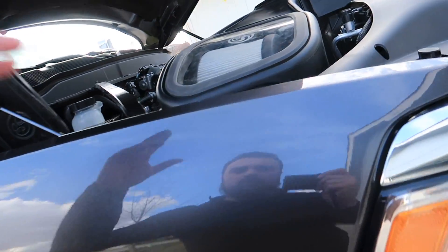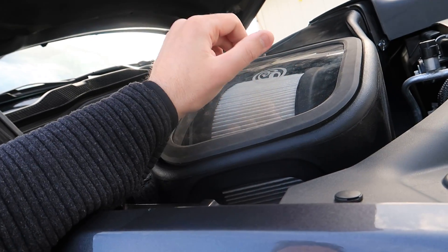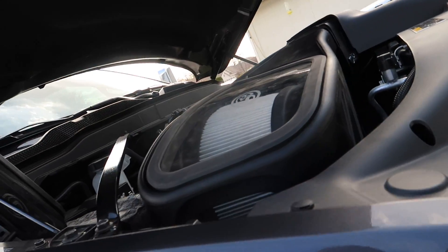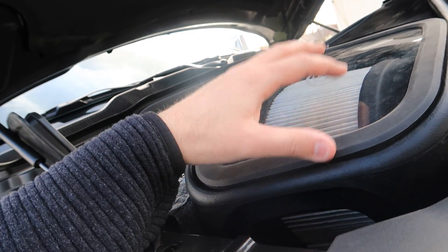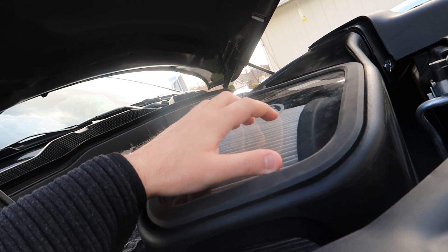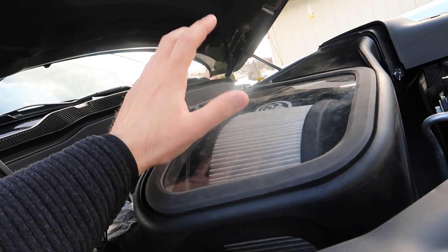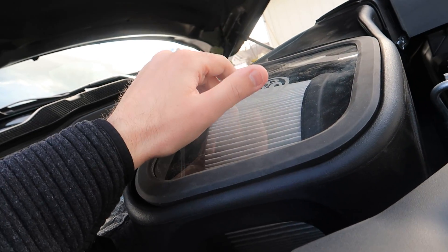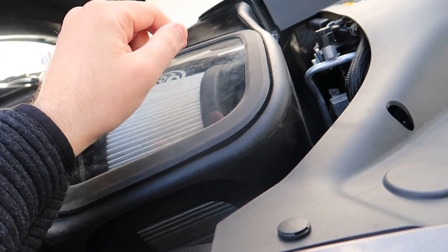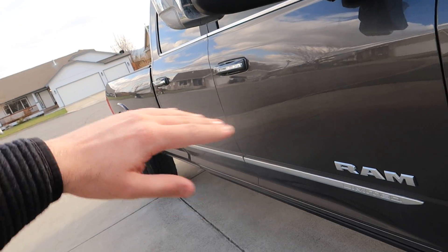With a couple thousand more miles down the road I'll keep you updated. I'm hoping for at least a mile per gallon better, but I need to run three tests and all three need to show improved gas mileage. On low and mid throttle, the turbo spools better — it's definitely a performance increase of about 10%. From around 900 RPM to about 1,500 RPM you've got more power; this thing just lights up the turbo easier.